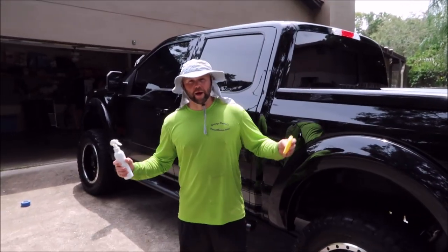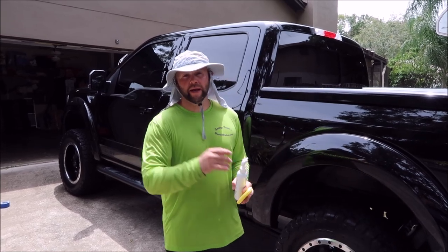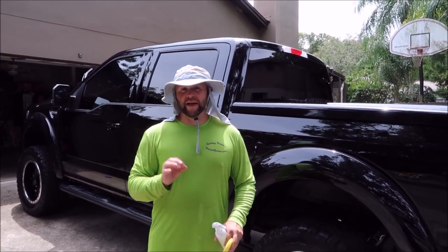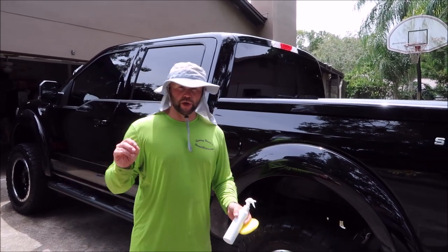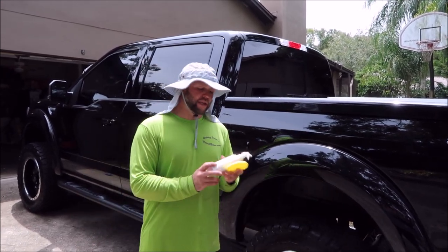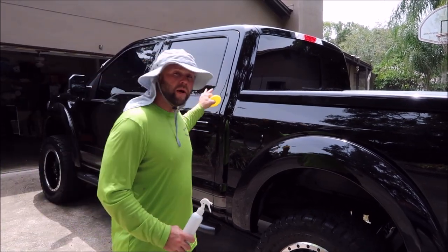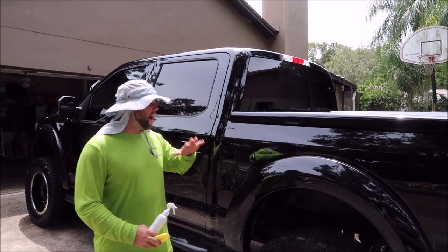Hey guys, Gary Dean, detailjuice.com. Recently I put up a video about being able to blend Universal Coating and Ultra Endurance Max Coat — consumer and pro — together 50/50. So one part of each product makes one concoction. You mix it together as you need it. I only have about an ounce in this bottle that I mixed up. You want to mix it per use — every time you're going to use it, mix it fresh. It's not stable together for a long period of time; you have about six hours once you've mixed it.